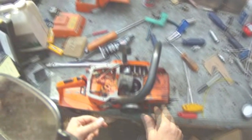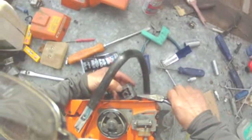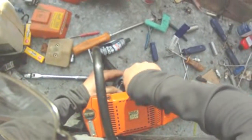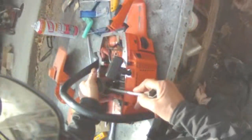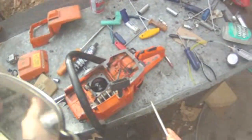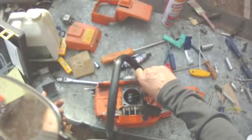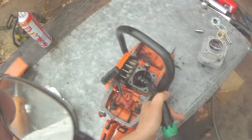This guy's been using some really bad oil in here — this thing's a mess, scored pretty good there. See how easy the piston pin comes out. One of the clips took off somewhere — you've got extras, you don't need it, just make sure it didn't end up in the crankcase. You just don't want to put a lot of load on this crank, on this connecting rod, sideways, or you'll twist it and then it won't fit. Let's clean out the crankcase — this is gas with some mix in it.